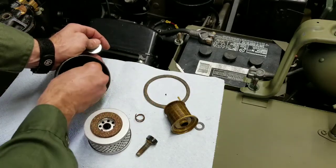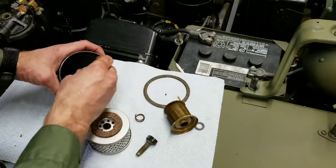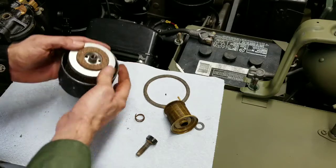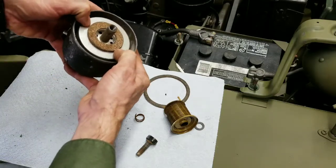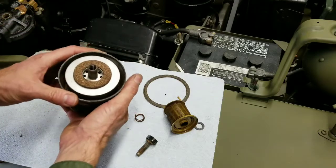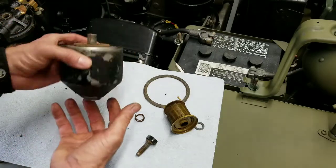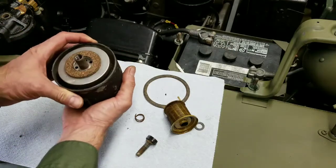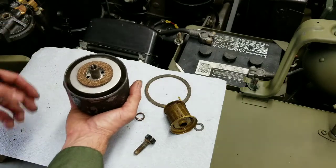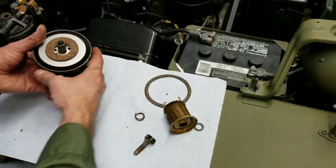The rigging I'm going to do: I've got a spring that's a little too big because it slides over the bottom of the post, so I'm going to put a washer in and my spring, and then install the fuel filter. You can see it's got a spring action to keep it pressed up against the top of the housing so that raw fuel in doesn't mix with filtered fuel out, preserving the functionality of this fuel filter. The right thing to do is get a new bowl without a corroded post and a new spring sized for the job — but until then, this is how I'm going to take care of things.